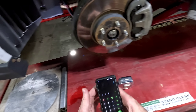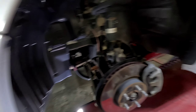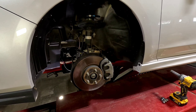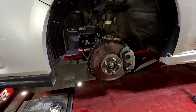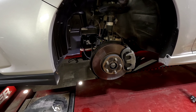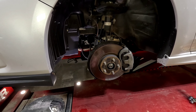At 10 and 7/8 — somewhere around there, less than 11 and definitely not 11 and a half — I'm going to conclude that all Impreza Limiteds have a 10.9-inch rotor, the 277mm smaller one. If the Limited has the smaller rotors, then the base and premium trims also have the smaller rotor, and the Sport must have the bigger 294 millimeter rotor.